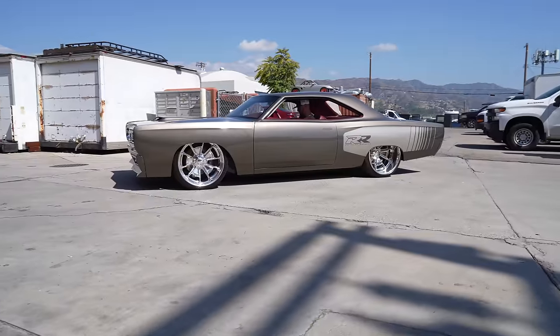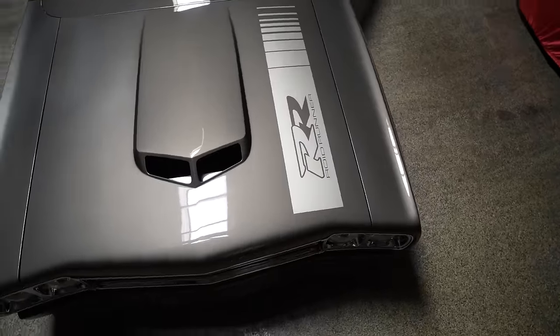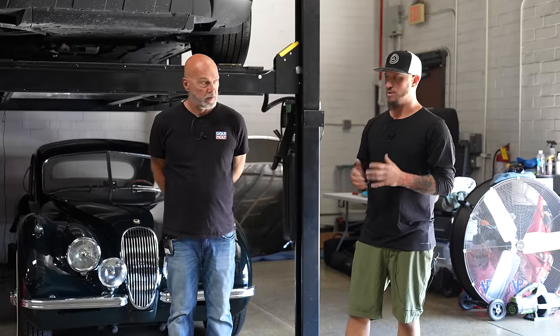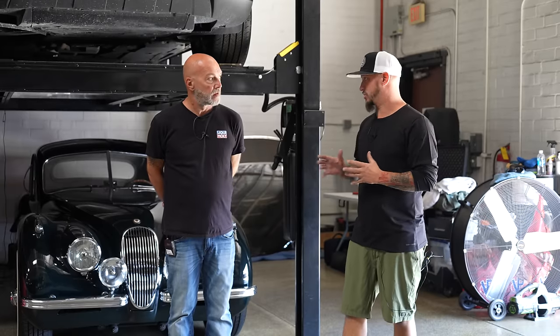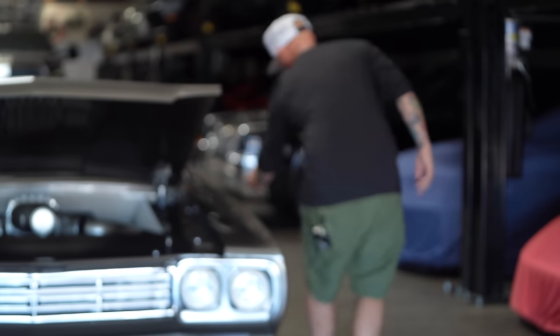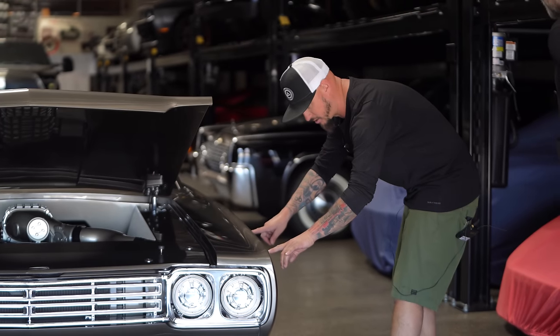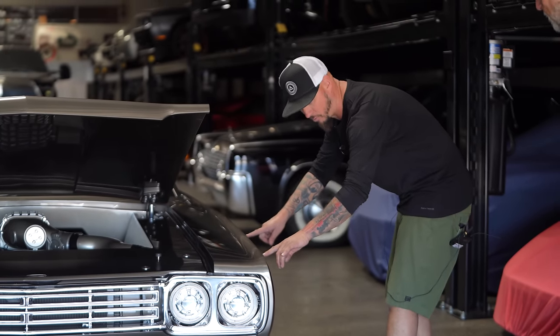The tops of the front fenders and the tops of the doors are factory from point to point. We put the fenders through the planishing hammer, and we stretched the front fender an inch and a half here in the bubble, right? So very gradually through here. Then we took the body line and we moved it up on the car about 3/8 of an inch from factory.